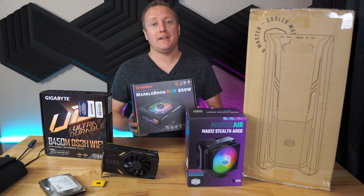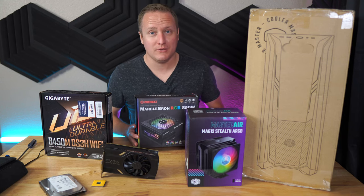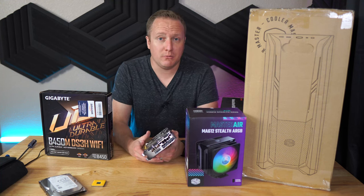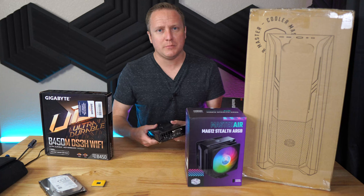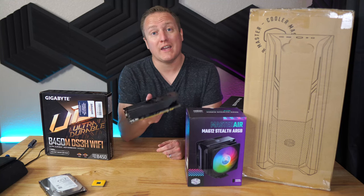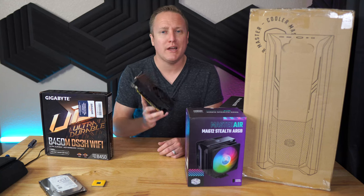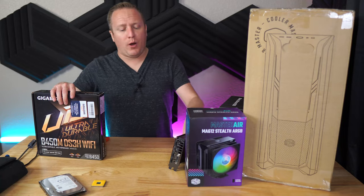But I guess for the future we know that my client's son is not gonna have to worry about power ever because he's gonna have more than enough to power even some of the biggest, most power-hungry GPUs out there. So for GPU, we've got a GTX 1060 3 gig. Now this is not a super huge upgrade over the previous GPU. I mean, it's pretty sizable considering that the other GPU was only powered by PCIe slot power. So we've got one that requires dedicated PCIe power, only a 6-pin. So this giant power supply isn't really gonna make a whole lot of sense, although that's setting them up for the future. However, we got a really good deal on this card. That's kind of the reason why we're including it. It's kind of the initial cost that I told my client in order to get some upgrades for this PC. But this GTX 1060 3 gig is still gonna be plenty good for gaming performance at basically all 1080p levels on most modern titles. Guys, those are the parts that are going to be the upgrades.